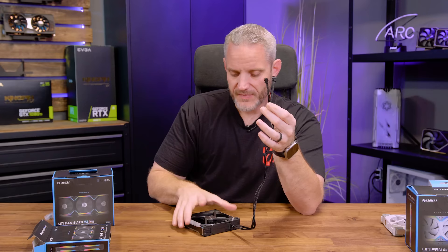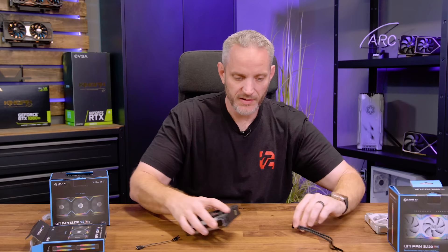There is a downside — because there's no such thing as a perfect product. The single fan does not come with a control box, so it has to be universal. They provide an adapter: a JST header to a 3-pin ARGB motherboard header. By clicking that in, it's now adapted to work with any motherboard that has a 3-pin ARGB header, or any compatible controller or splitter. The fan header is just a standard PWM header, and if you need a longer wire, you just get an extension cable.